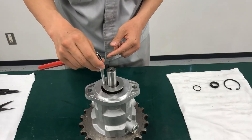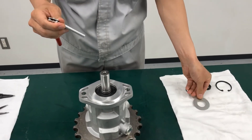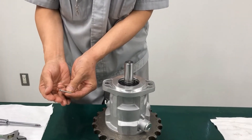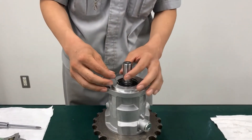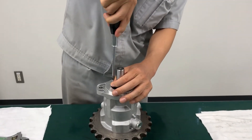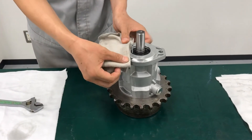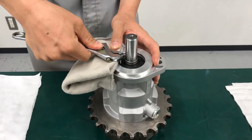A magnetic tool may be used to remove the support washer. To remove the shaft seal, carefully drive a small sheet metal screw into the shaft seal. Be careful not to damage the bearing below the seal. Using a slide hammer, wrench, or an appropriate pulling tool, pull from the screw head to remove the seal.